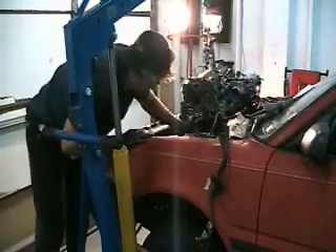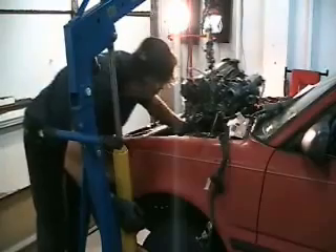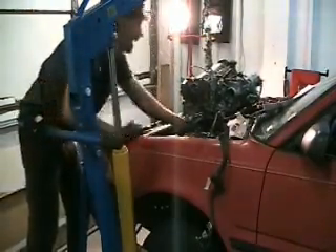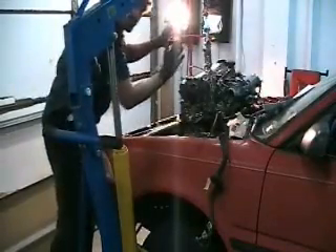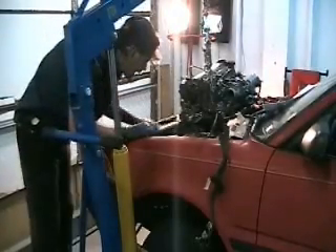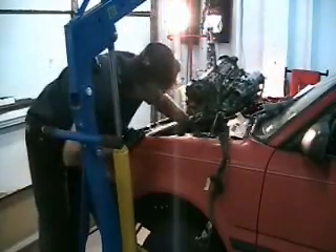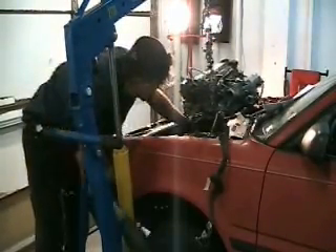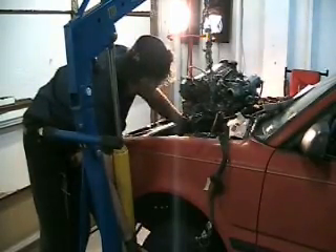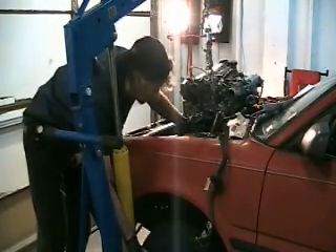When you set this engine back in, it's a lot easier with two people. What you want to do is really push the engine. It won't be that hard to do, but you want to push it, because as the boom lowers it's going to push the engine further out, further away from the transmission. Right now the engine is sitting almost exactly on top of the transmission, so I'm going to have to push it over to the other fender and then lower it very gently. It's a good idea to practice a couple times lowering the engine, because if you move this lever too fast, the engine is just going to plummet.